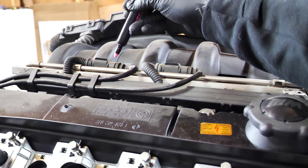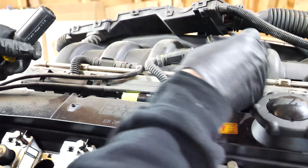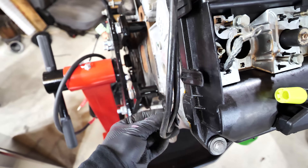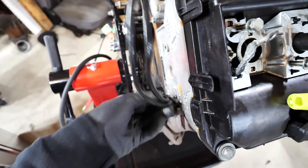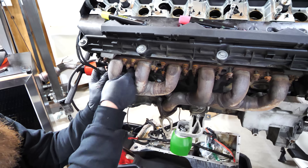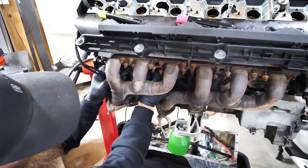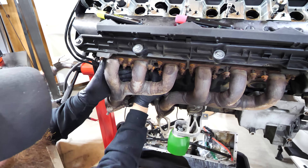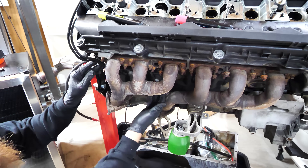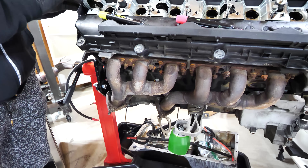What I'm going to do is mark these banks — mark this one with green and this one with pink. These are the little connectors for the O2 sensors; they just pop out of here. The green connector runs right down next to the valve cover. There's a little metal bracket you're going to have to weave it through. There are two little hooks down here right off the engine block.